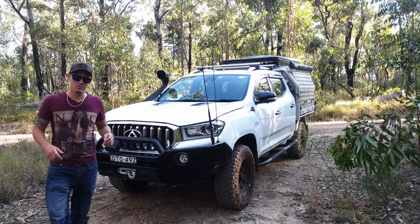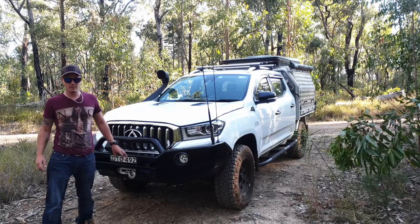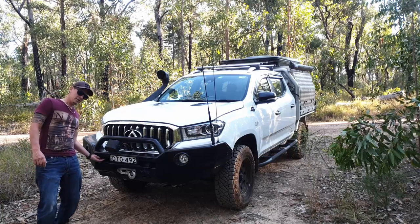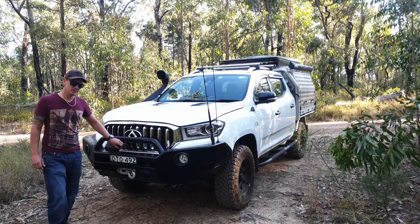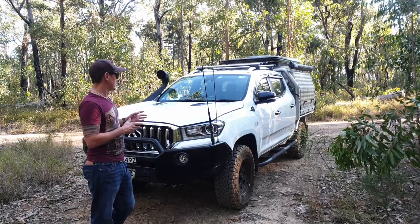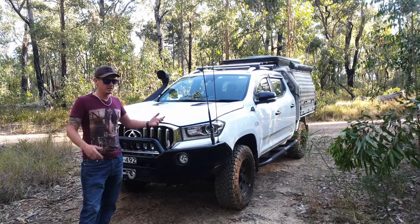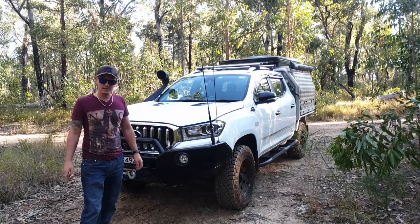I have got the Ridge Ryder 12,000 pound winch, simply connected at the front. These are winch-compatible pull wires. I've mounted the control box up high — the reason being if you've ever been nose-first in a mud hole trying to get yourself back out and you're fishing around for the connection port, you'll appreciate having it higher up. On the front of the car I've also added a bit of rubber stripping that I had left over. It can fall off at any minute but I might put it on permanently — still deciding if I like the look.